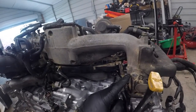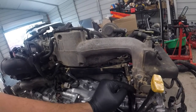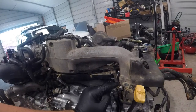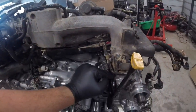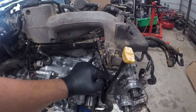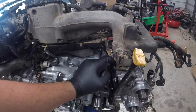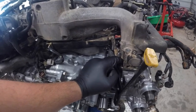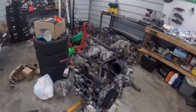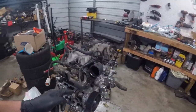These usually do not leak, so I won't replace them if someone hasn't already loosened them. On this car it was removed at the bottom — I'm not going to replace this one because I had to take off more stuff, and these metal ones usually don't leak. The cardboard ones at the bottom are the ones that leak. So the mating surface on the head was cleaned, I cleaned the surface on the intake, and blew all the dust and residue off. Got everything mostly pre-assembled.